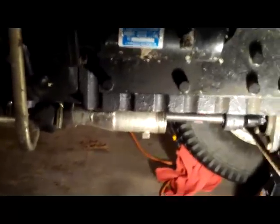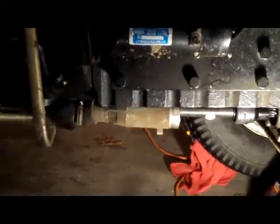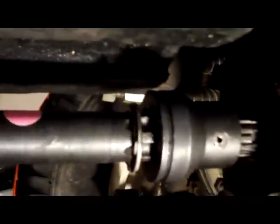So the break lies somewhere underneath the end of that drive shaft and the corresponding socket assembly leading into the front differential. Now, if I try to jimmy this a little bit back and forward on its spring, I can't get it to engage. So now we're going to have to take that assembly apart and figure out what's really broken here. So what you can see here is that drive shaft is freely rotating in the drive socket. The drive socket itself is not moving. The shaft is. That's because the ball bearings have fallen out.